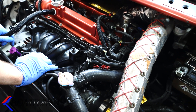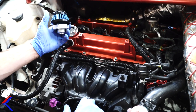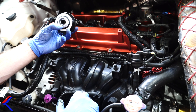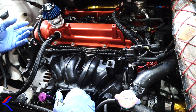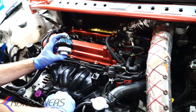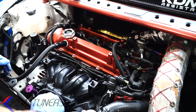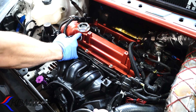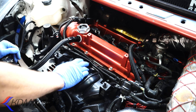Moving forward, what you guys have probably been seeing is these vented caps. The idea behind the vented cap is exactly the same as drilling a second vent. The ones we're having manufactured have a 50-micron filter on the bottom side, so you can run this by itself and not have any oil come out. The ones we've sent out so far are handmade with no micron filter, so some are making an oily mess and some are not — every engine is different. We decided to do it off the cap to make it easy so you guys don't have to drill, because on the inside of the valve cover it's impossible to drill practically. And if you ever want to sell your car, with the cap you don't have to go find a new valve cover.